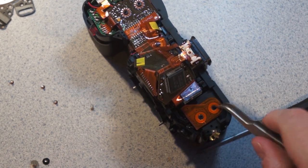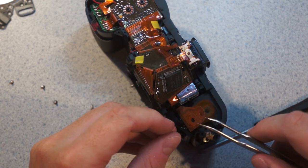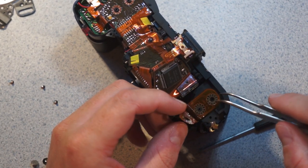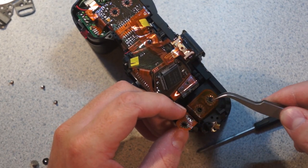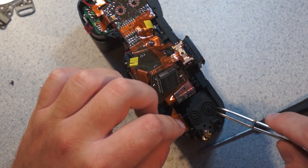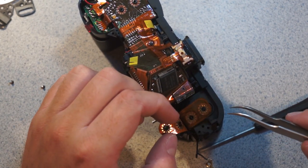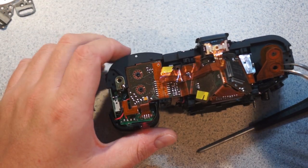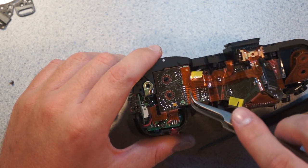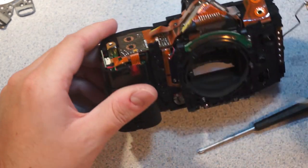And then we just have the two flex circuits, which just have these little gold pie slices, and the pie slices just get smooshed together, and that's your contact. It's very strange. I haven't seen it anywhere other than in cameras. And it looks like there's some shaped plastic down here to control where the pressure goes. Seems like a really involved way to join two flexes. I guess it's reconnectable. I mean, you look over here and they've just got this flex rigid circuit board soldered down to this section of flex. You can see that's just soldered on.